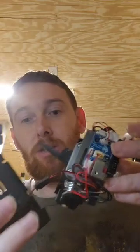Now that we've got all 3 of those screws out, we're going to move this little lever forward and slide this piece of plastic off, being careful of the fan connector for the part cooling fan that's inside this little shroud. With that, you just undo the little connector right here, and then you can set the plastic piece aside and not have to worry about it.